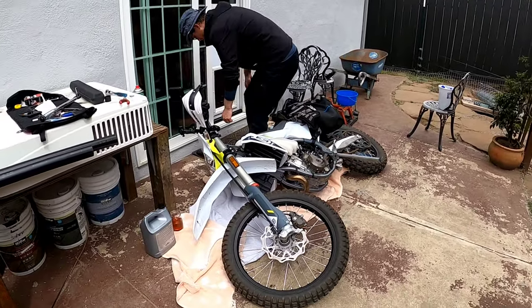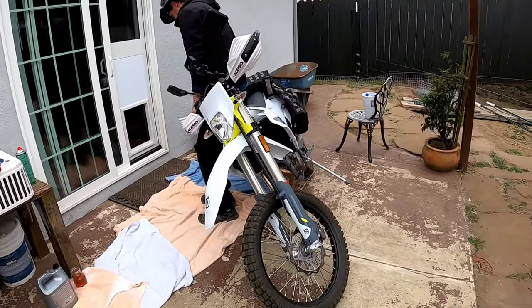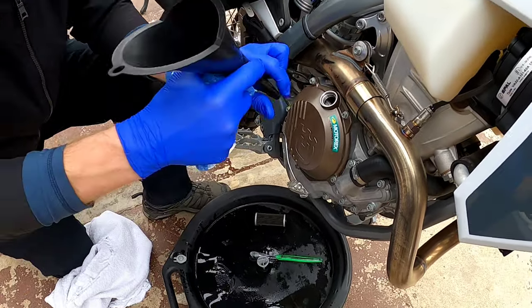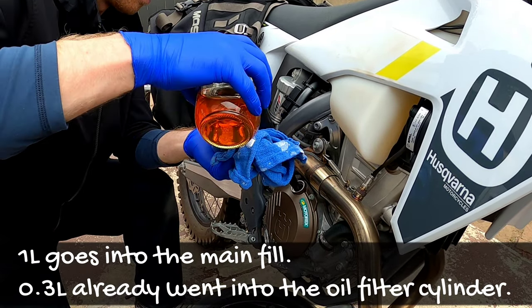Now it's time to put the bike back up. I'm just going to pop the oil cap off here and hold this funnel while I pour in my measured oil. After you fill the main engine casing with the one liter of oil, it's going to look like you've overfilled it because the side glass will look really full. This is why you have to start the bike afterwards and run it for a minute so that the new oil circulates throughout the engine. Afterwards, when you look at the side glass again, it should be at the right level, which is basically around the middle.